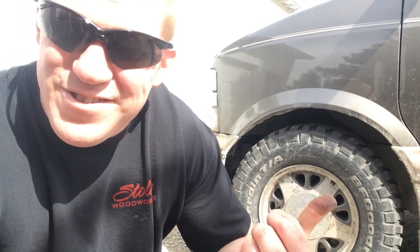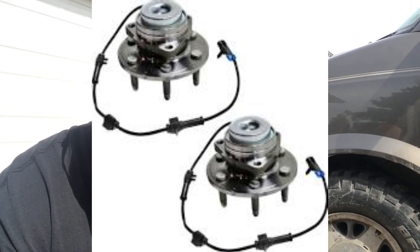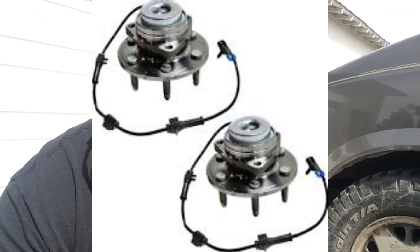If you don't want to pull the fuse out, here's the way to actually correctly fix the problem. I can't say 100% this is going to fix your problem, but this is what I would do if I was going to put the fuse back in. There are wheel sensors — two of them, one on each side of the van. What happens is those sensors get corroded and dirty, so you might be able to take a wire brush and clean out the sensors where they stick down into. Or you could just buy new sensors. After I'd just put a whole bunch of work into the van, the last thing I wanted to do was buy sensors.